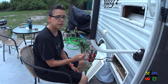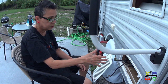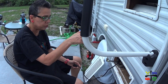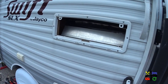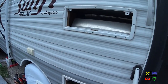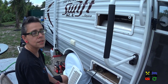The next thing I did is very easy — I just unplugged it. It has a dedicated plug right in here. There's also a screw on the bottom I took out because I figured it might prevent the fridge from sliding out. On the top it has two metal sheets that direct the airflow from the bottom to cool the refrigerator. I'm going to remove them just to be thorough, and then start taking a bunch of screws out from inside.